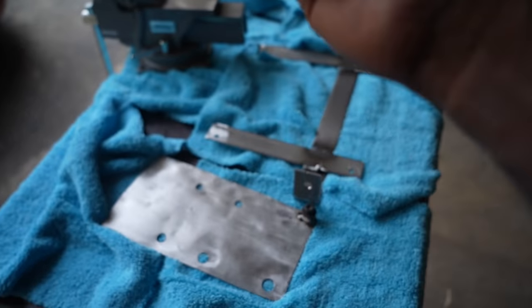Right, here is what got achieved. This is the positive cable. I've passed this through here and you can see I put it very nicely. It looks just like OEM. And the black one goes all the way here and passes through here. You can see that it goes underneath this bar. The reason I went underneath the bar is because one day I may happen to remove this bar, so it's going to be easier for me to work around here. It passes through here and goes all the way to the negative. So this one is the ground or negative, however you want to call it. This is where it's tapped into.